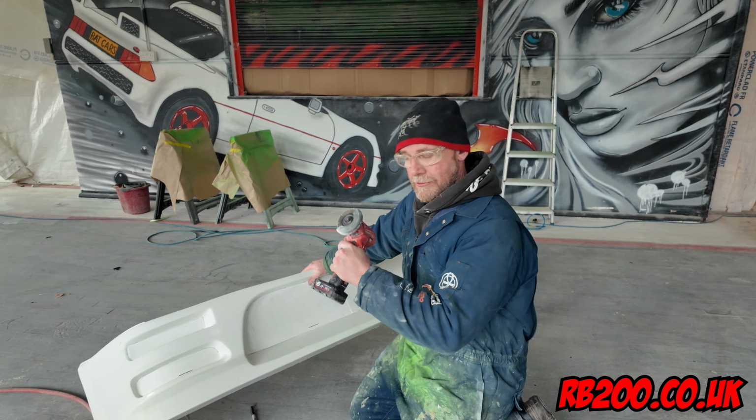And then what I'm doing is I'm using an air saw to go in there and cut from this side, so I can see the line perfectly and cut along that line, and then I'll just sand those edges. It's kind of easier to cut it out from the back. Some of the cutting you might do from the back, but you can't exactly see where the edge is, so you need to give yourself a bit more meat, and then sand it down. You could do the whole thing like that and then go around it again. Yes, I'm going to just go in there and cut along these lines.